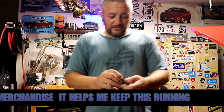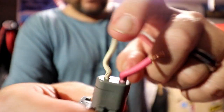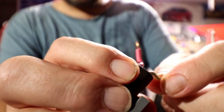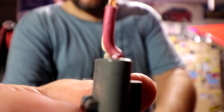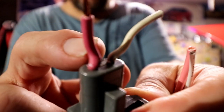So I knew these wires here were suspect. This big red wire is the power, and this white one is the TAC. The white one looks really bad — it's a smaller wire and it's kind of cut open here. And look at this red wire — it's a bit deformed, doesn't come out straight. So I'm a little concerned there may be some damage to the wires in here.